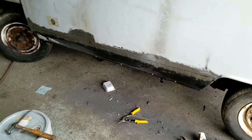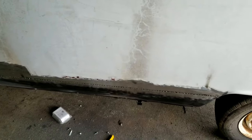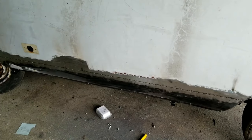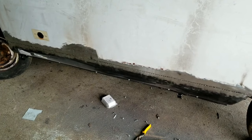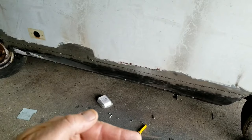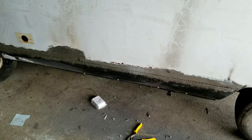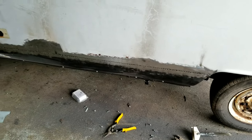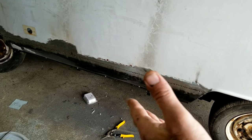Take a look at where we ended up here. If you have those little end pieces on the pillars, you can get a little better shape out of this. But these things come a little bit off the roundness, so if you notice when I put it on, it was sprung, it stuck out about that far, and I just sheet metal screwed it in. If you want to play with it, you could take a dolly and hammer and smooth that out, or you can buy the Gerson green ones and they fit better. A lot of guys buy those, they are more expensive again. So I've done them this way and just left them like this, okay? It ends up looking okay because it's a round area.